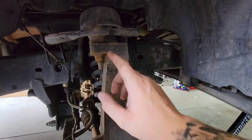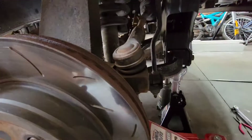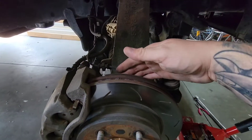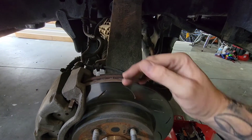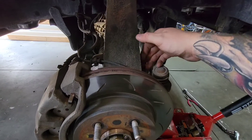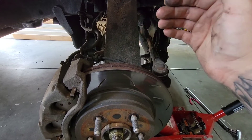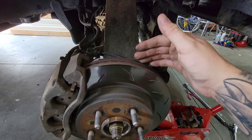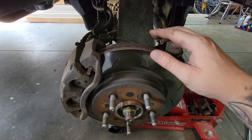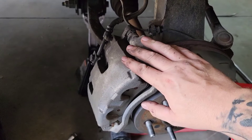Even on a stock setup you can do it by only loosening the top ball joint. Then we'll loosen the outer tie rod, and go behind here to take off the brake caliper and rotor. Get the spindle nut off first, then loosen the bolts for the hub assemblies. If you think you might need new hub assemblies, this is a great time to do it — otherwise we'll just jump in to do the axles.